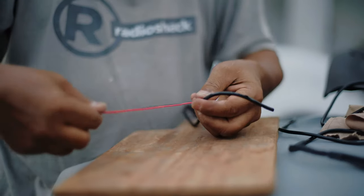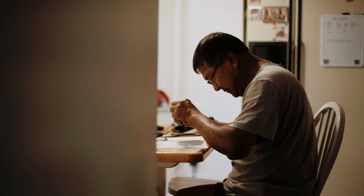The next thing we did was split the cable. We knew we had to run it to the fuse box and just needed that extra length for the ground wire. After that, we soldered the power cable to the fuse tap.